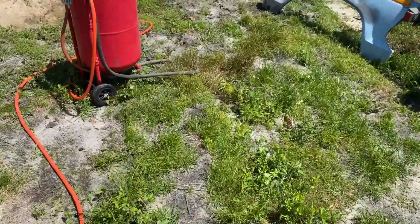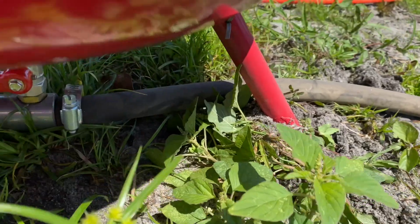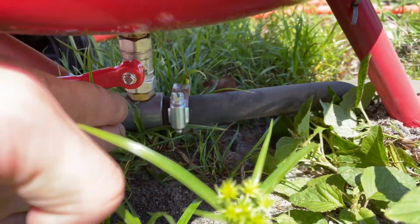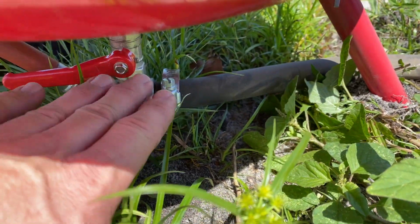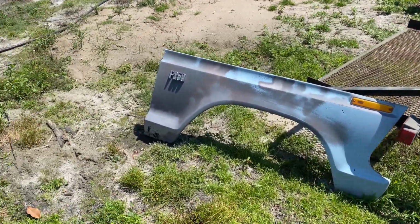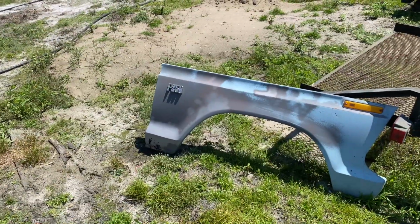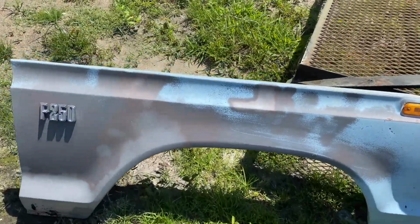It's got the same issues it was having before, where the hopper, you have to adjust the output here. You don't want to adjust it all the way because all the sand will just blow out. You got to get it just barely. It's off right now, and just turn it down a little bit, but then it kind of gets clogged. There's some modifications that guys have done to make that airflow bigger down there, but all you got to do is just mess around with it. It'll open it back up, but yeah, it's working.